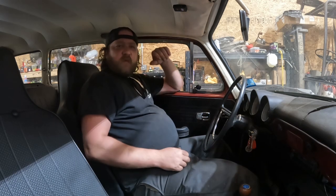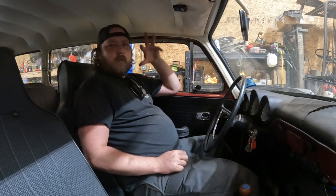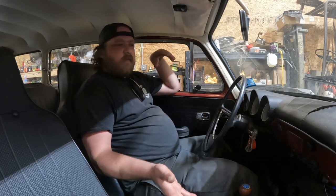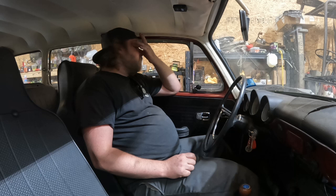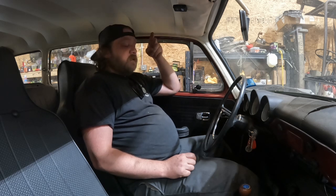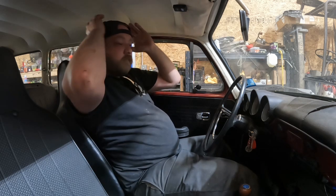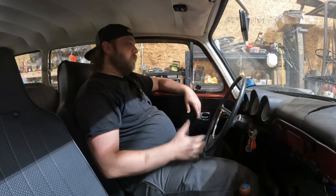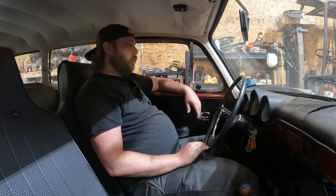But one thing I did do when I first got this car, I think I mentioned it in my intro, is charging. I had a misinstalled voltage regulator, and I want to make sure that's good. Obviously I don't need to drive it, but driving is more fun than sitting and watching it idle for 45 minutes. Plus it'll work through the rev range. Second, I still have that old wheel cylinder on the back. I want to make sure it is functioning as it should, so I want to get some heat in the drums and make sure it doesn't blow, because this car is obviously still in my possession. I also want to get miles on it to make sure everything else isn't going to leak, pop, or screw up. So it's just a safety check. Plus it gives me a reason to drive it.